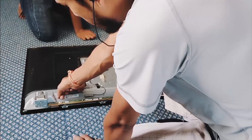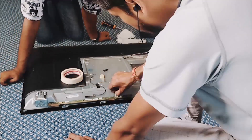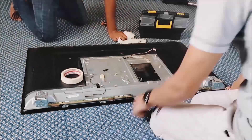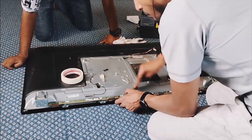Look, this is the TV's speaker. Now we are going to take out the screen — we have to work very carefully here. First of all, I will disconnect the T-CON cable from the TV body which is connected to the screen. After that, I will open the attached glue, tape, and screws removed slowly and very carefully.